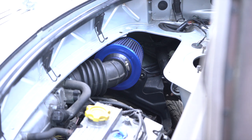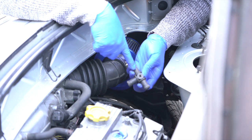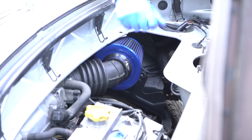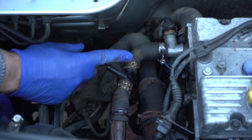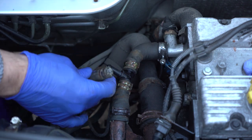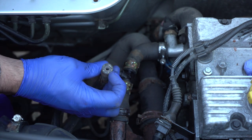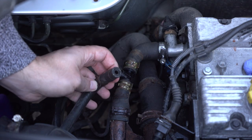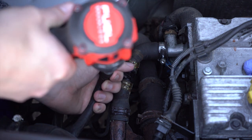While I'm on this side, when I disconnected some of the coolant pipework, this T-piece broke off, so I've got a new one to put in. I've got this union T-piece in on three sides, but the fourth hole looks much smaller - it turns out some of the broken-off pipe from the old one is still stuck in there. So what I'll do is put an M8 tap in there, which means I need to drill it out first.